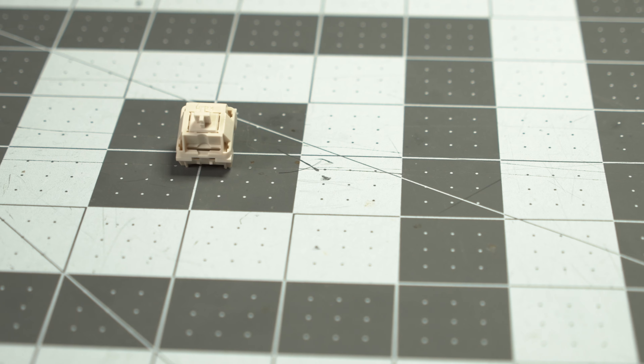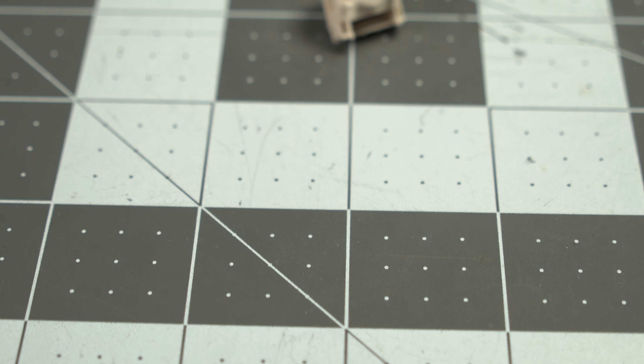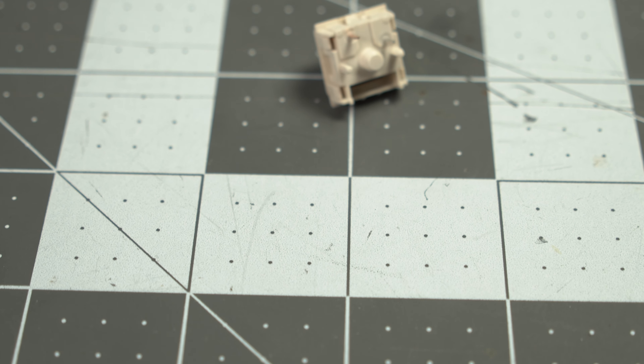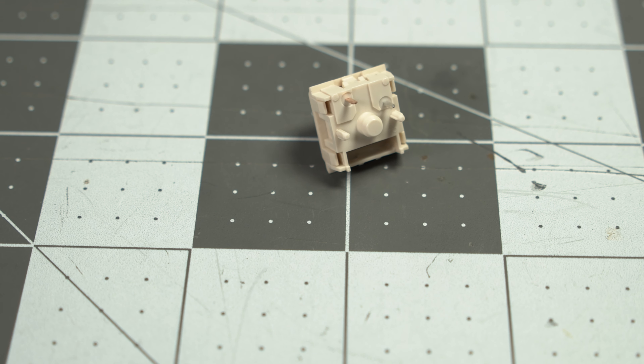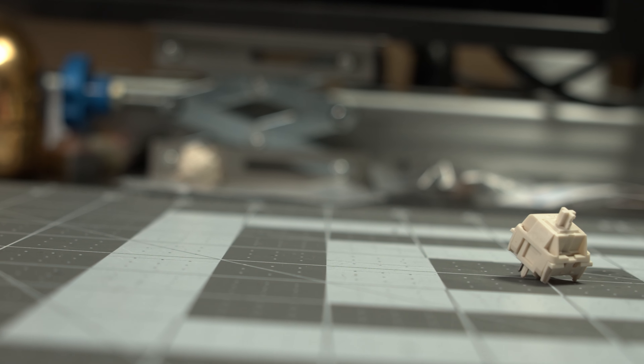So physically, the switch is pretty much the same as most standard MX switches. It has PCB mount locating pins on the bottom, although on some PCBs I do find them a bit on the small side, so keep that as a heads up if you want to use them for a plateless build. Something I've noticed about the POM housing: it's definitely a bit more brittle than the traditional nylon blend switches are made of, and I find it easier to snap POM top housings by accident, unlike with normal nylon housings. It's nothing to worry about in general, but if you're using thicker switch films, that's where you may encounter some issues.